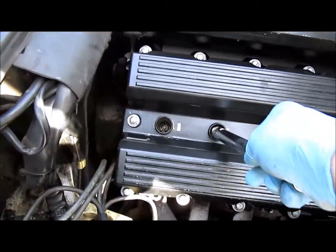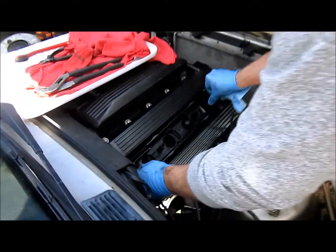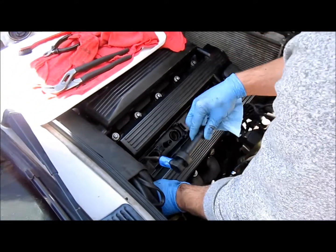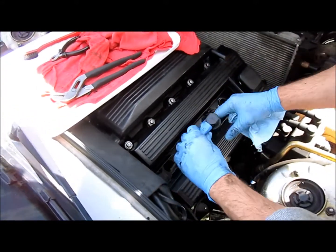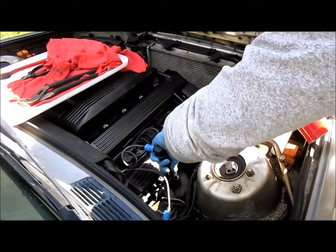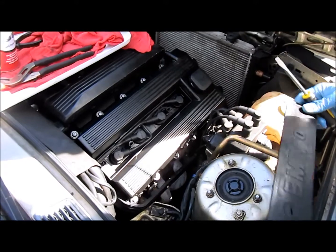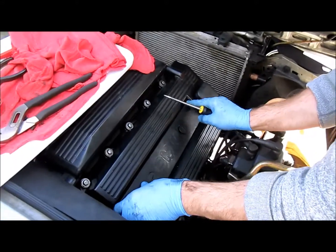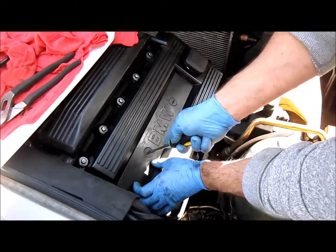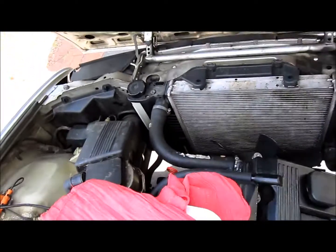Once you get all the bolts in, don't over-tighten them because they'll strip. Put the spark plugs back from where you got them, and don't over-tighten those either. Once you get all the spark plugs back in, put this plastic housing back in — it just slides in and locks. Then go ahead and re-route the spark plug wires and the ignition coils. I have some electronic cleaner to use on the inside to get any oil out. Once you route the ignition coils the proper way, put this back on and lock it in without scratching it. Don't forget to reattach the breather hose that I removed earlier. That is it.